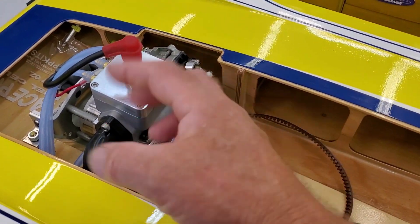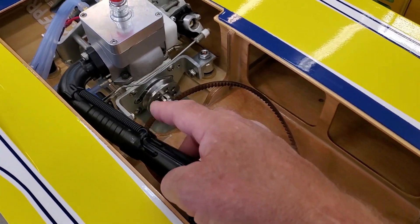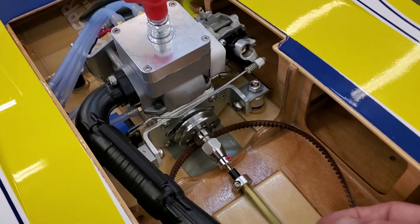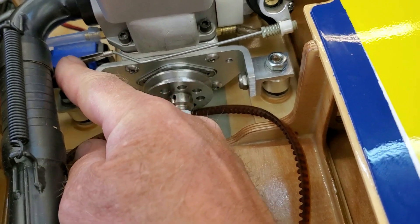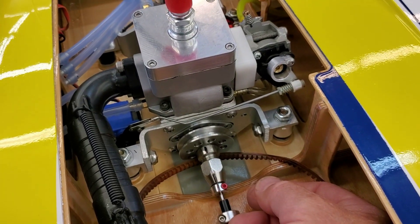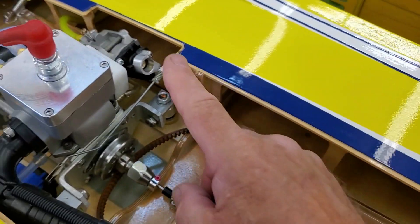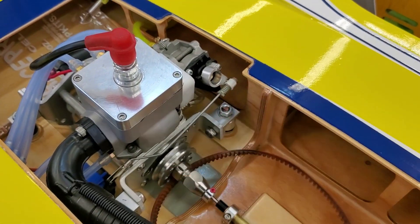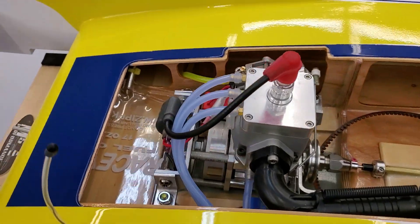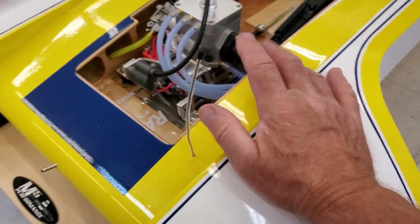I went full Quick Draw - this is their hot pipe, their flex coupler. By the way, this blows oil everywhere when I fire it up, partly because I had a massive amount of oil in the motor and partly because that's just the way these things are, especially when you don't have it tuned quite right. I have it set super duper fat. Throttle setup: I'm using a little tiny servo down here laying on the floor with just a short piece of rod. I've seen goofy bell cranks, long rods, servos, more connectors - too heavy, too many moving parts. Here I've got a straight shot.